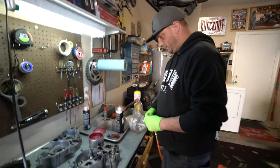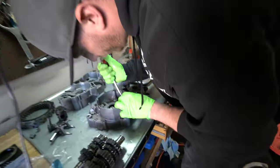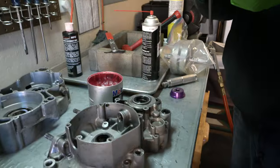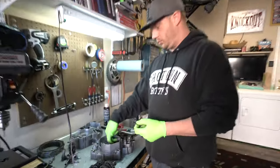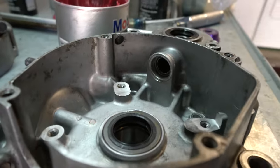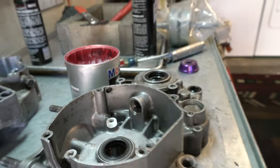This one right here — I'll use a screwdriver just to pry it out. This one doesn't have much press on it and this is the actual arm for the clutch — this is what activates the rod that pushes against the pressure plate. The arm sits inside here, and this is the seal that protects any oil getting into the stator housing.